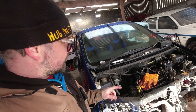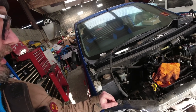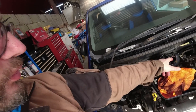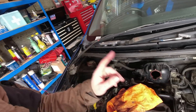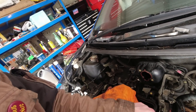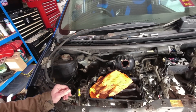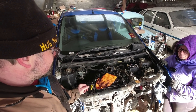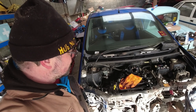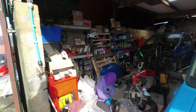We haven't quite reached the objective today - getting the engine out. Some jobs just take so long. We even had to remove the throttle body just to get a bit more access. We still have starter wiring, a few vacuum hoses, the clutch cable, and gear linkage to do. We'll also need to come back with a ball joint splitter as we can't get the drive shaft out. Unforeseen difficulties, but we'll order some bits and crack on - you'll see that in the next part of this video.